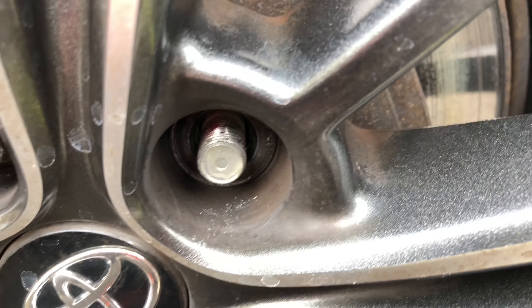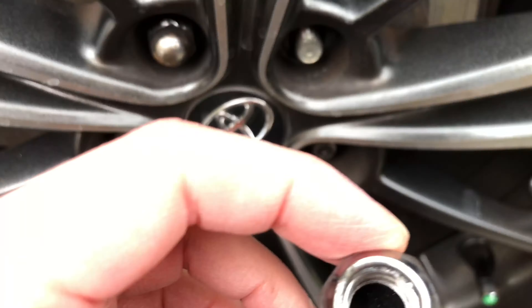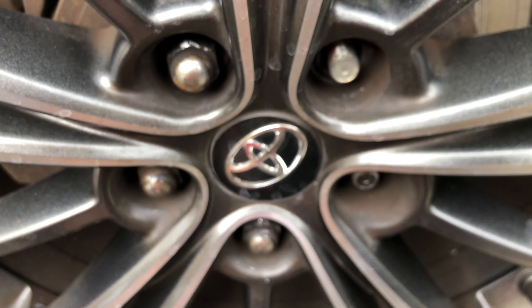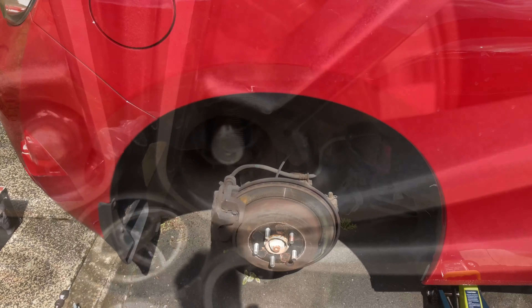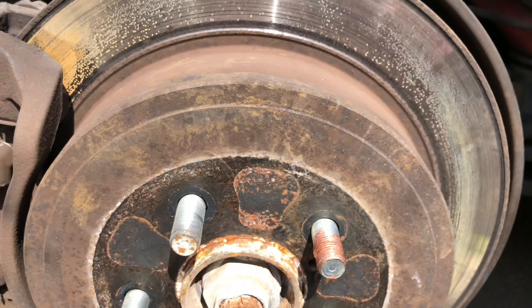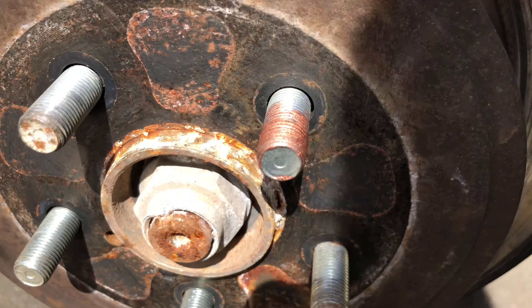This is slightly disconcerting — the lug nut was very tight coming off and I can see some metal filings. I've used an air duster to blow out all the metal filings from the lug nut and I'm going to use a wire brush later to clean the bolt, and hopefully that will solve the issue. I've got the wheel off, but there's a bit of bad news — this bolt here seems to be faulty or condemned because I can't get the lug nut to thread all the way back in.